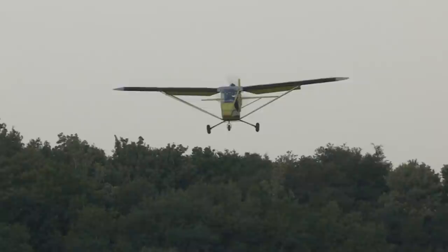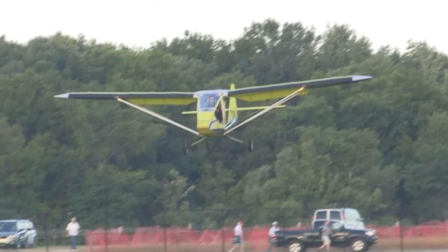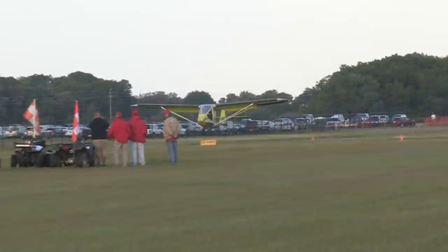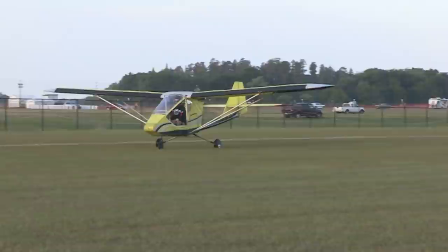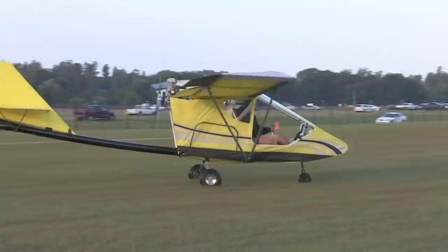If considering purchasing a used CGS Hawk, it is the ultralight flyer's recommendation that the plane's fabric be tested, the airframe, wings, landing gear, and the control systems be thoroughly inspected. If the history of the engine is unknown, it is recommended that the exhaust be removed and the pistons inspected for wear and seizure. At the time of production of this video, the ultralight flyer would estimate the value of a used CGS Hawk from the 1980s to be worth between $3,500 and $5,500.